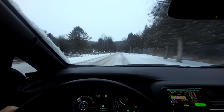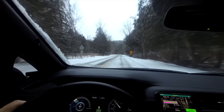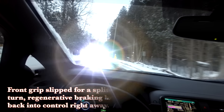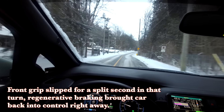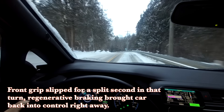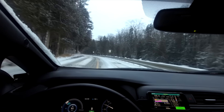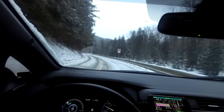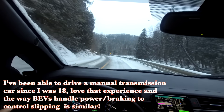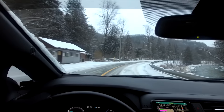This is the very first time that I'm driving this car in any amount of snow. I've been kind of chomping at the bit waiting for snow over the last couple of months to see how this handles. Here I lost it just for a sec — I let off the accelerator, and the car came right back on track because the regenerative braking kicked in just to slow it down enough and bring it back. So you don't have to touch those brakes very much. It's kind of like when you drive a standard and feel yourself going out of control — you push the clutch in to disengage power to the wheels, and it snaps the front or rear back into the direction you're going. This is a very similar experience with electric cars.